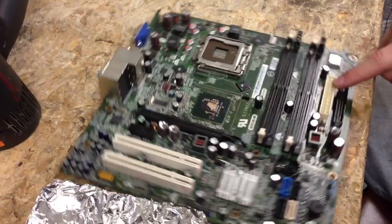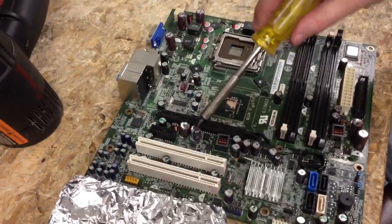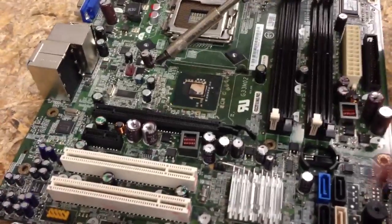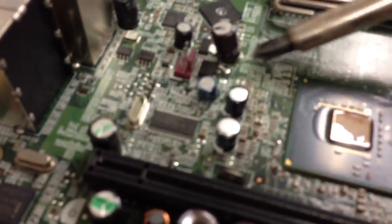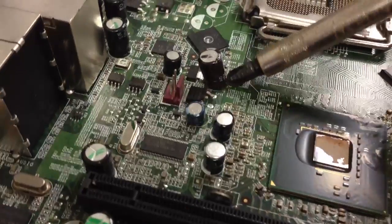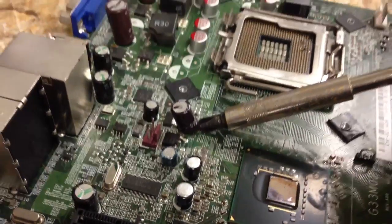As always, protocol — you want to make sure you don't have any power plugged in. The caps have already been adjusted, so they're at the right angle. You always want to make sure that you get a good discharge. I'm going to use a Phillips screwdriver and just get underneath there a little bit, just to make sure it's nice and discharged for a couple seconds.